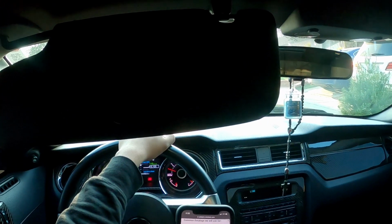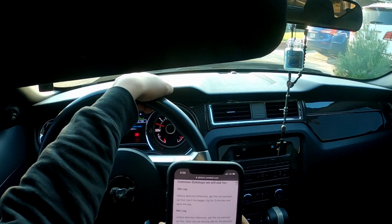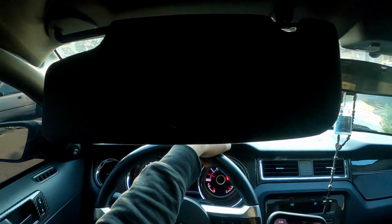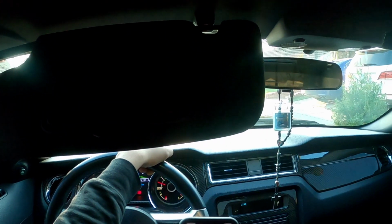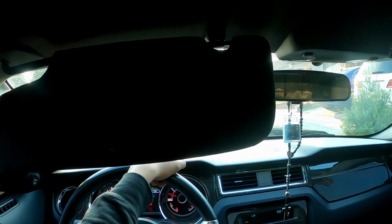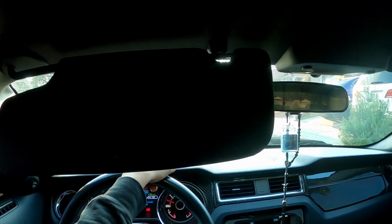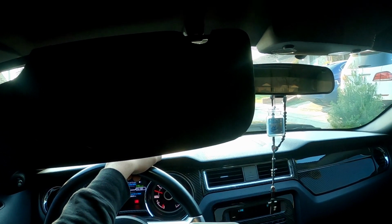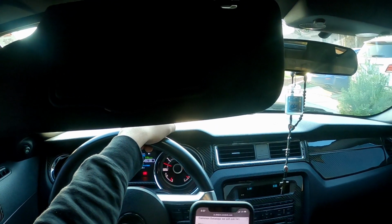Depending on your tuner, they'll ask for either an idle log, and the idle log is a log for 3 minutes. First get your car warmed up to operating temperature, and then log it for 3 minutes. You start your logger. On the screen you'll see a timer. It should be on the top left corner of the graph. You'll see the timer, and right at 3 minutes you can stop it. I left it probably for about another 5 seconds just to be on the safe side.